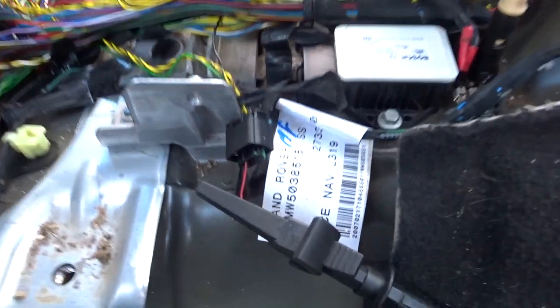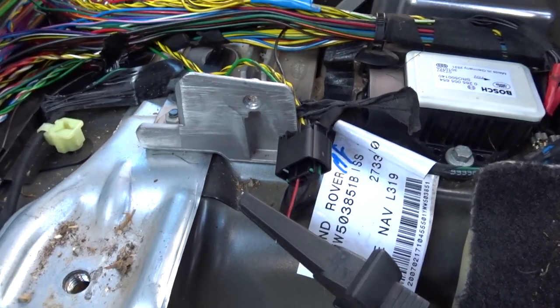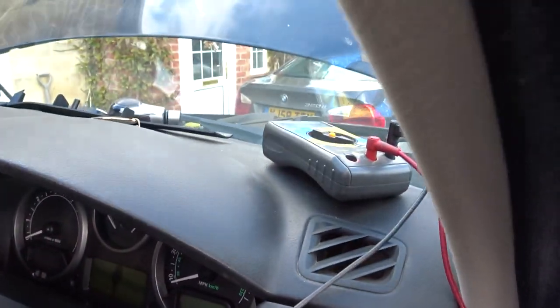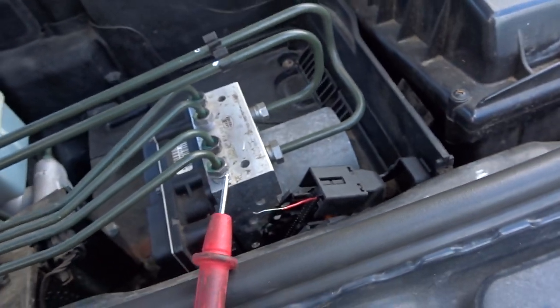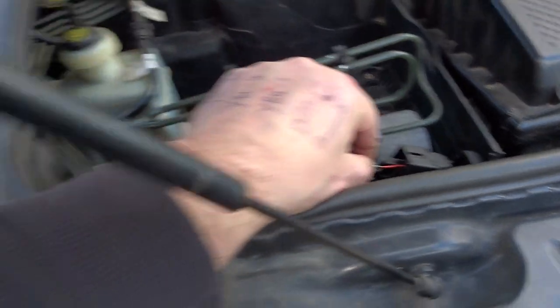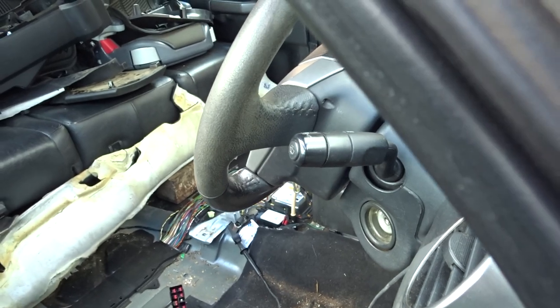So what we did, we connected onto the yellow-brown wire from the yaw rate sensor, which sits there, so we're testing the yellow-brown wire that goes up to the meter there. We'll go around to pin 45 on the ABS sensor. We're testing it - you can hear the beeping. That's the brown one. Tested it out okay.